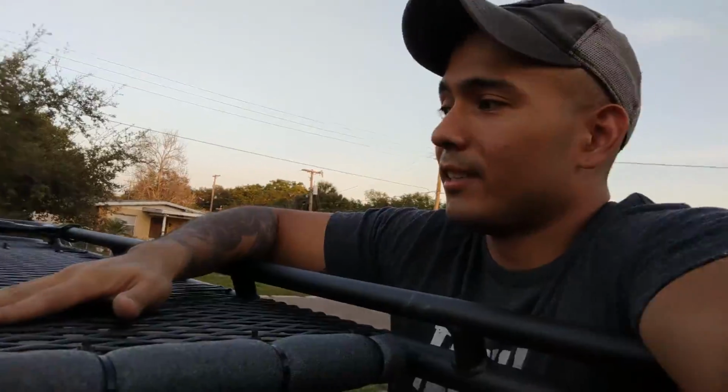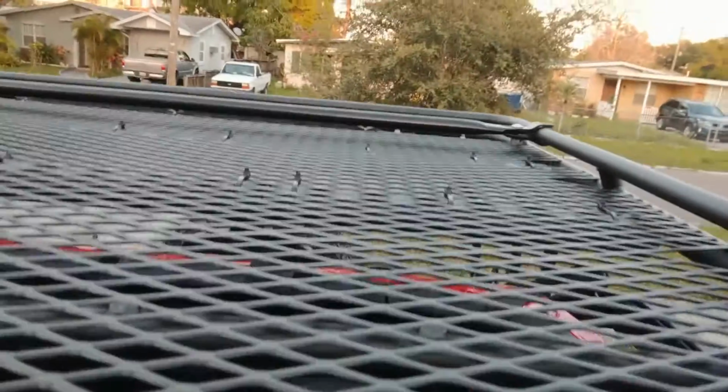The back was the biggest example of this. As you can see, I have a whole bunch of foam, put it everywhere. I should probably put one more right here, but that's where all your noise from the soft top hitting your roof rack will come from. Using these foam pads will severely take down the flapping noise.